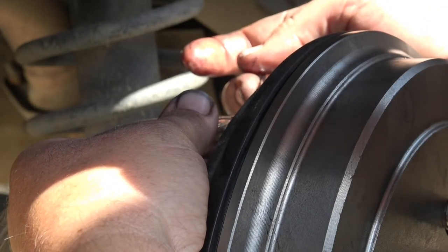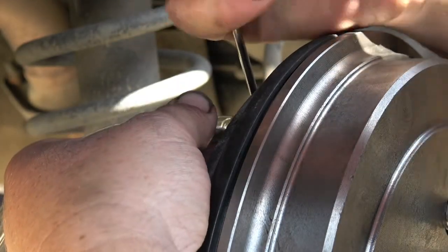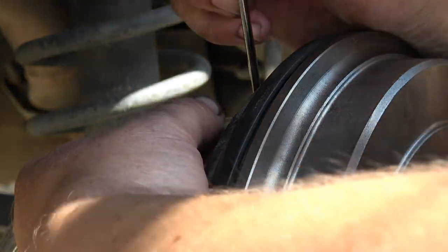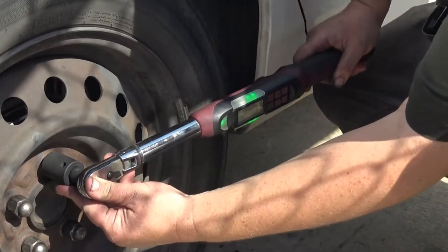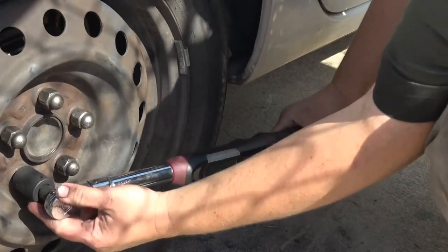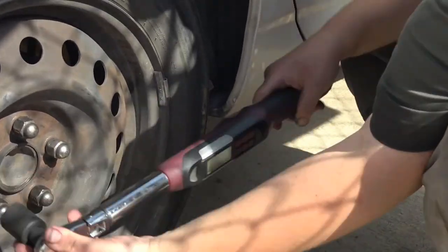This is one of the last steps before you start mounting your tires. Just make sure that you bleed them. Double check the master cylinder as you're doing this because you do not want that to run low — be mindful that you get all the air bubbles out; otherwise this fluid will not compress. Once you've completed the bleeding procedure, you can put your tires back on and start torquing them down. If you have any more noise associated with the drum brakes, you will need to listen for adjustments, maybe bleeding, and hardware after that. I hope this video helps you guys — thanks for watching.